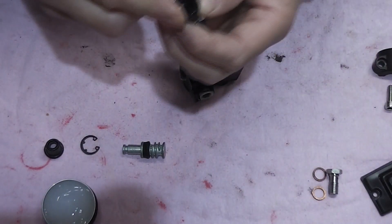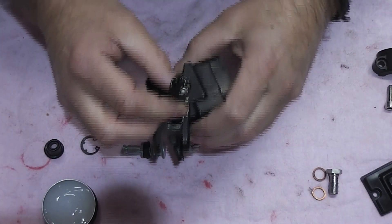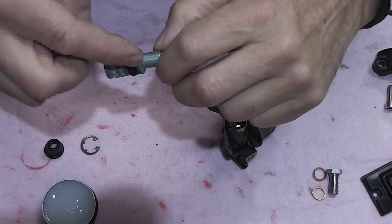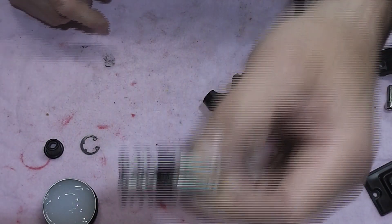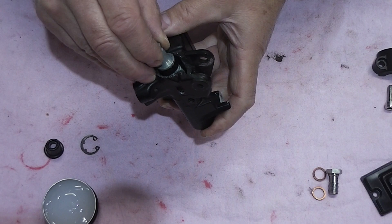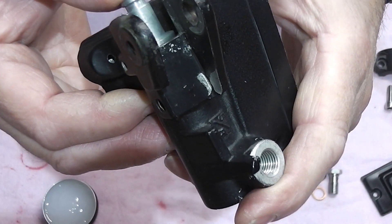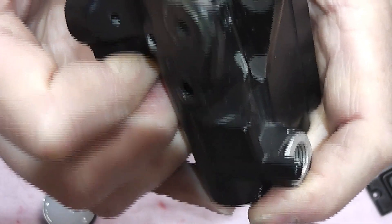Put a little bit of silicone on there. You don't want loads of this stuff — just a light smearing. Drop that in. Next is your main piston. I'm putting the smallest amount you can imagine on there, because don't forget this thing uses brake fluid. That's in — ease it in, and that little bit of silicone helps the piston go in without the rubber chafing on the side walls of the cylinder bore.